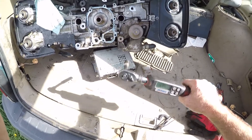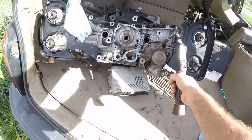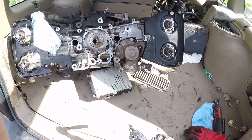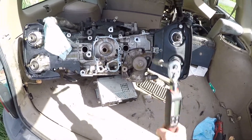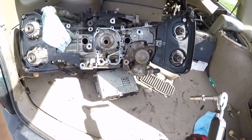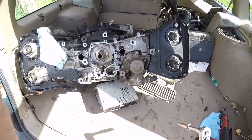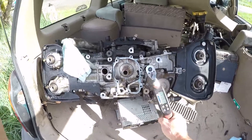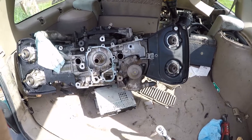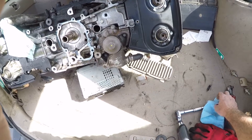I have to go review the video, but luckily most of the time these bolts — at least in poor condition, older, rusty bolts — can handle up to twice what the torque spec is. Now that doesn't mean you should do that by any means. Because kind of like with an oil filter, the tighter you put this thing on, you may actually end up inducing a leak — though it is a metal gasket, so maybe not. I wouldn't push it beyond the 8.9 anyway, because if you do end up snapping one off in there, not so cool to have to undo. Hope you enjoyed this video. Now that you know what the limits are on the torque specs of these water pumps on the Subarus, use that 8.9 wisely. Thanks.